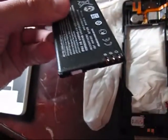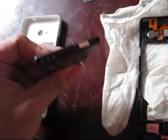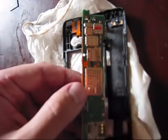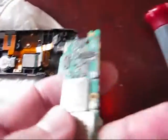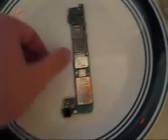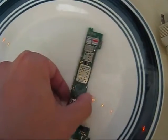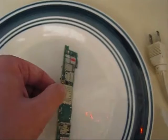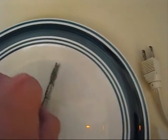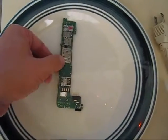As you can see, there is no water sign on the battery itself — the sticker is white. But that doesn't mean you will have no water damage on the logic board, like it's happened in this case. Completely remove the logic board, disconnect this cable, and let's clean everything thoroughly. Using the isopropyl, I made sure I cleaned the whole logic board all the way around so no corrosion will build up in the future.